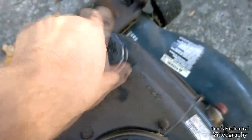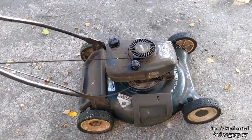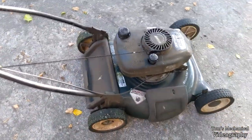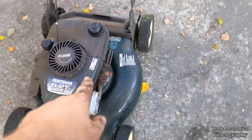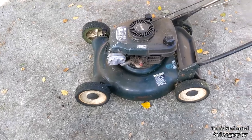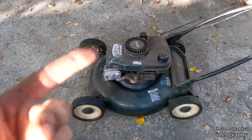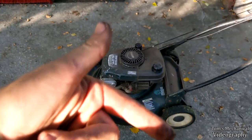For basically the cost of oil I got a free yard mowing. During this gas scare, the cost of oil is actually probably cheaper than gas for lawn mowers — so yeah, free yard cutting. She obviously needs a new spark plug and a new air filter, but she does run and she does cut grass. I had her set way too low so she bogged down a lot, but not bad. I think this is going to replace the five horsepower Craftsman I've got at work. If you like this kind of content, go like the video. If not, comment and tell me how much of an idiot I am — any engagement helps. If you want to see more of this garbage, smash that subscribe button. Tom out.